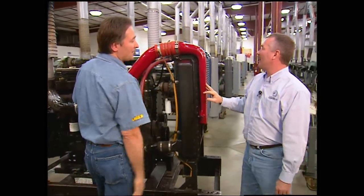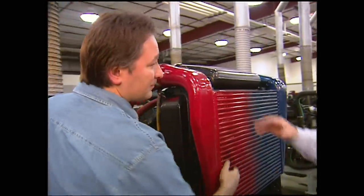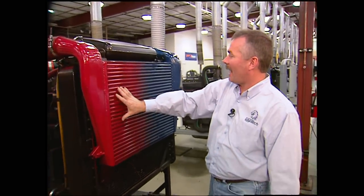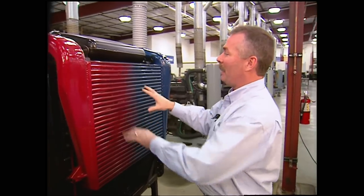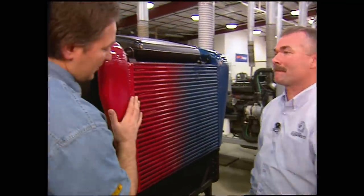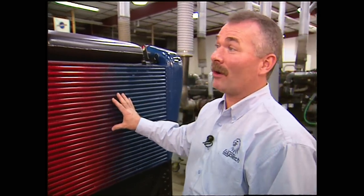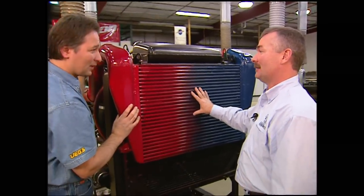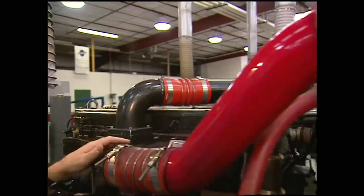What kind of heat do you have coming through this? We're probably talking between 300 and 350 degrees at maybe 32 to 38 pounds of boost. You can't build any power with that kind of temperature — we want to try to knock that down to keep the temperature out of the engine. What happens is we have 300 to 350 degrees coming across the front of our after cooler. We have the outside temperature coming through it, cooling it. Depending upon the temperature of the outside air will determine about how much cooling we get across the front of the after cooler. What kind of temperature drop do you get? At least a minimum of 100 degrees, and it can be more depending upon the outside air temperature. So then that cool air — boom — into the intake: power, strength, everything we're after.